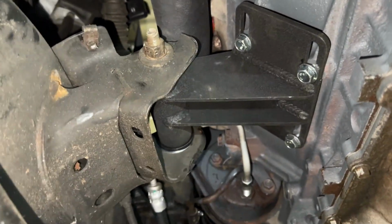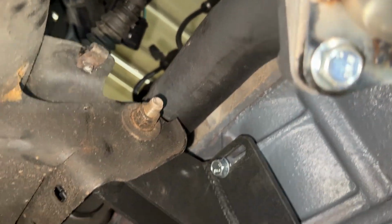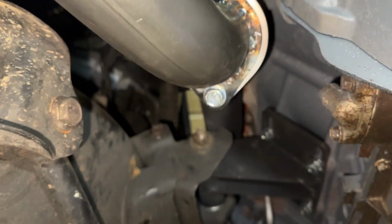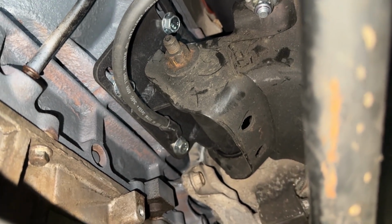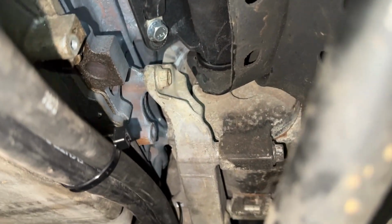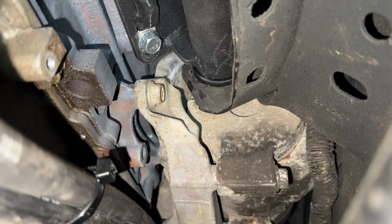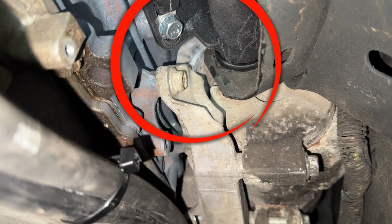There is the driver's side mount, it's the long mount, and then the LS3 cast manifolds, and you can see how much space is here on the driver's side. It's great. And then the short side motor mount, with the long section goes to the rear. Again, the long section goes to the rear on that one. You can see that's a factory truck AC compressor. Way up there in the corner, you can see where I ground out a little bit of the extra cast so there's some clearance around the motor mount.